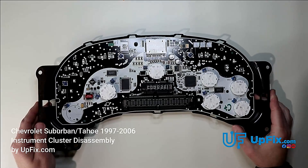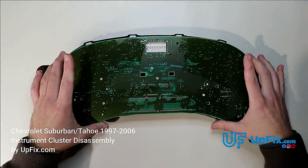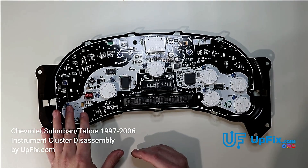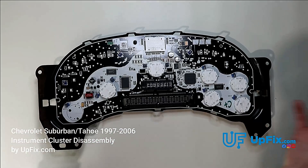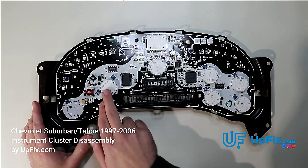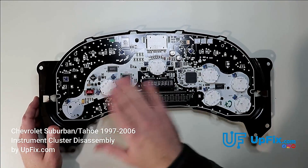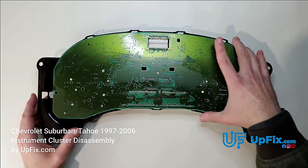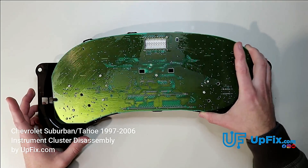Here's the circuit board. Now that the circuit board is open, you can see what you have to fix. These circuit boards, particularly the 03-06 boards, typically have lots of issues. On some clusters, the incandescent backlighting bulbs are removed from the back with needle nose pliers or a screwdriver. In this case they have to be desoldered, so if any of them are bad we pretty much replace all of them — if one goes out, they typically go out in batches. We desolder all six stepper motors, replace them with brand new ones, put in new power components, solder anything that needs to be done, and take care of anything on the back side — any corrosion, solder cracks, or cold solder joints. We also need to test the plug to make sure there's no intermittent connection.